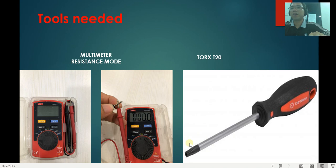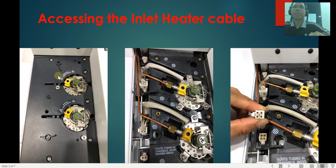The second tool that we need is a T20 Torx. The heater cable for the inlet is sitting underneath this cover, so you need to remove this screw to take it out. Then it will look something like this. This is the back heater sensor cable, and this is the front heater sensor cable. You will have two thicker wires and two thinner wires — the thicker ones come from the heater and the thinner ones come from the sensor.